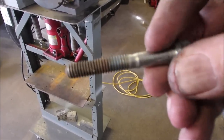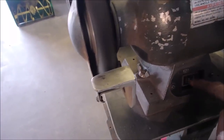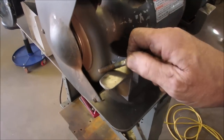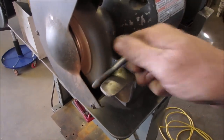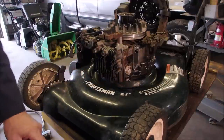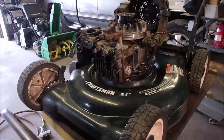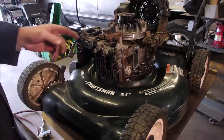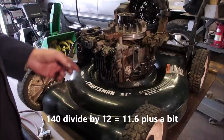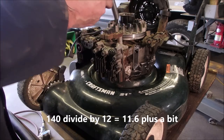These are the head bolts — they look pretty bad. As you can see I'm just buffing them on the wire brush side of my grinder. We're torquing the head gasket on. That Briggs spec sheet is great — it has everything: 140 inch-pounds. I've gone one round at about 9 foot-pounds and a second round at around 13 foot-pounds — that's where we are right now.